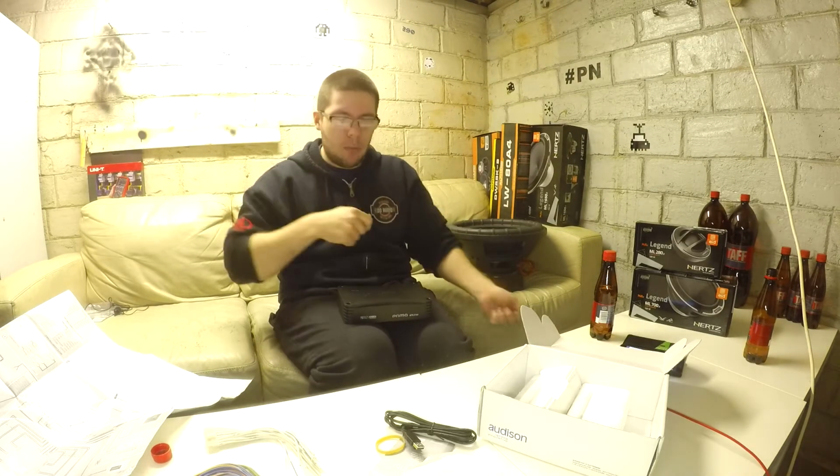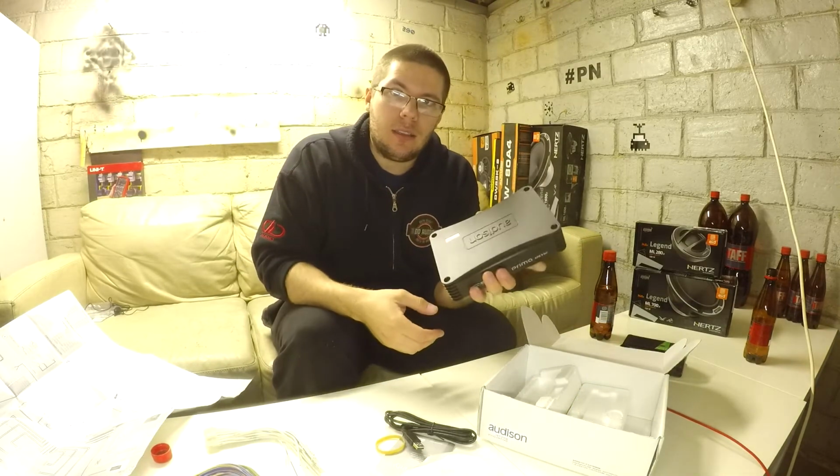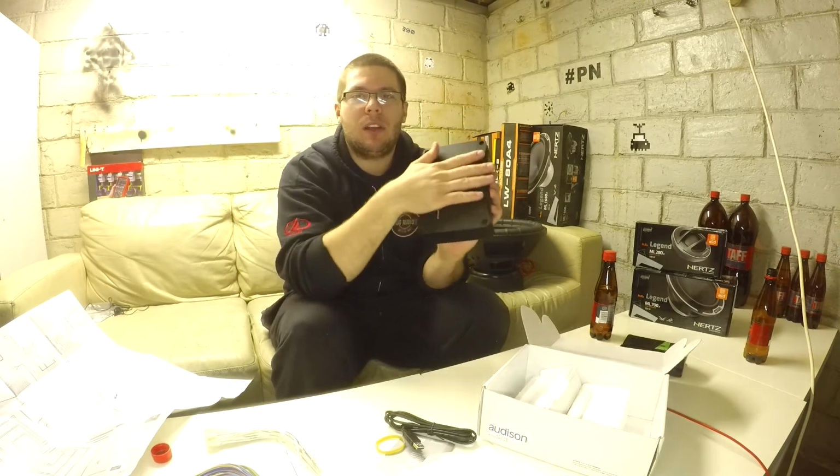so you can have a dead center stereo image in your car system without thinking what I need to divide by what, or what the length was, or listening to every speaker. You just measure, write it down into the DSP, and it does everything for you, like it should be. We are living in 2017, we are very wise and we have technology to calculate. Why on earth do we have to make our own decisions and measurements and tell the amplifier how far away it needs to be? The amplifier should tell us. We just give it real world measurements, where the speakers are, and that's it.